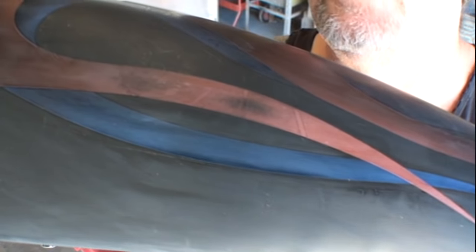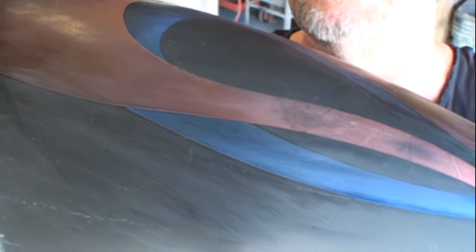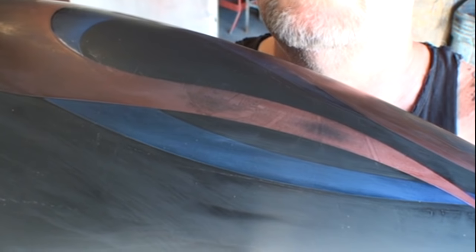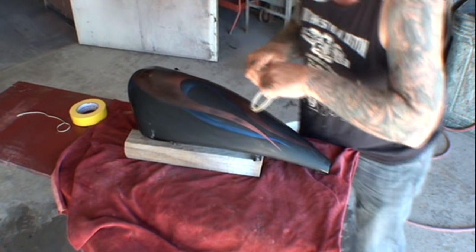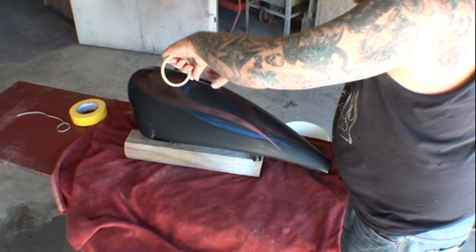If you look at the red flame right there, you can see where I burned through it sanding. You can see right there. So what I'll have to do — I was wet sanding the blue flames down to get the tape lines off and I sanded through the red flame. That's not a big deal. It's not anything to have a heart attack over because that's actually an easy fix and I'm going to show you how easy it is right here. So what we're going to do to fix that — we are going to actually tape this flame off. We're not going to tape the whole thing off, just part of it, and I'm going to show you why.